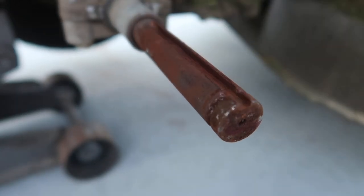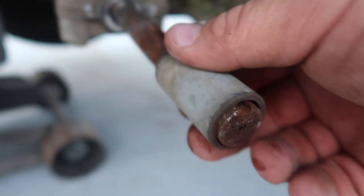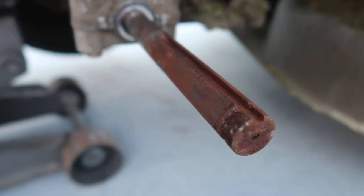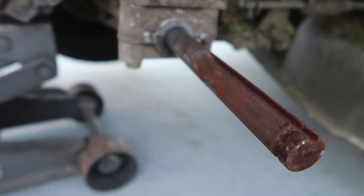This is your rear wheel axle. That's the rear wheel axle keyway and key I just removed. Here's a spacer and next is a washer. Make sure to put those back in order when you're going to reassemble the wheel. This is what the inside of the wheel looks like and how the keyway fits between the axle and wheel.